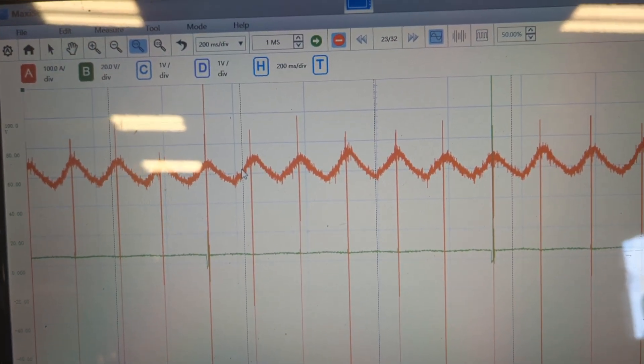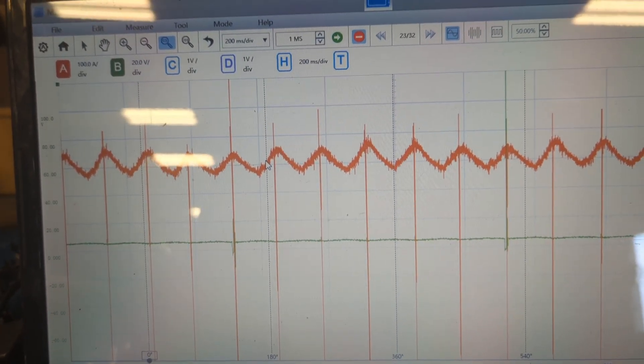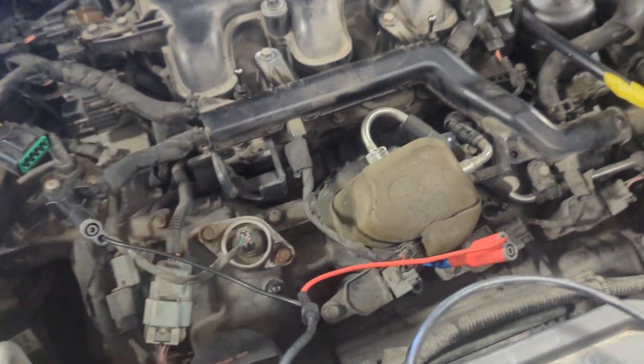So what I'm gonna do right now is take out coil number two since it seems pretty low, and we're gonna use an endoscope or a camera to verify inside and see if there is any damage in that cylinder. Let me take out the coil — just a 10 millimeter. All right, so this right here is normal, nothing really going on with that. I'm gonna turn this ever so slightly and we should start to get in there — there they are. This is normal, and keep turning — there's the scoring on the cylinder wall. We can also see a lot of oil on top of this piston. I'm pretty sure there's blow-by going on and we do have a loss of compression.